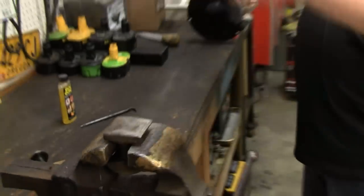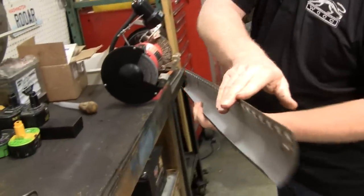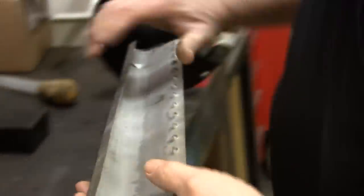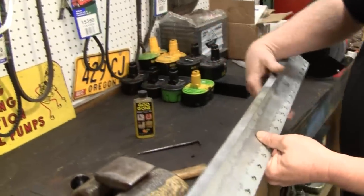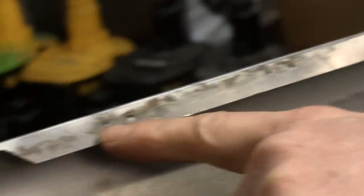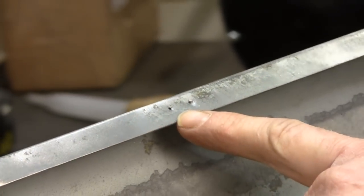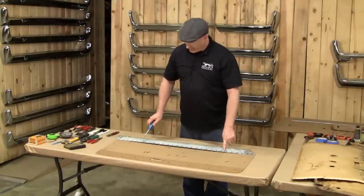Let's take a look and see what we have — that looks pretty good, nice smooth transition. These panels are indeed arched; it's not a straight piece. The glue that's on it you can use something like Goo Gone to remove it. You can also prime and paint this if you want. Also wanted to show those original holes from the original beltline strip — we're going to reuse these for alignment for the vinyl cover, and then we're going to drill and make new holes for the new beltline strip.